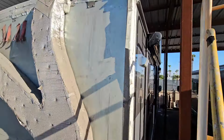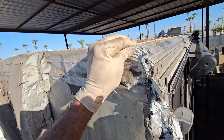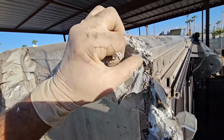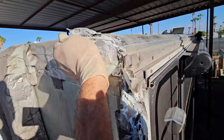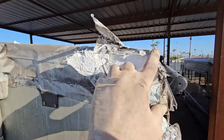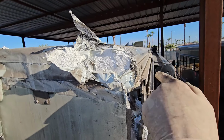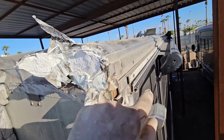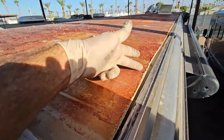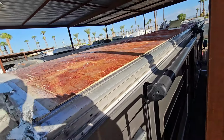But on this 2009 Winnebago Journey, they changed this radius extrusion. I wouldn't say substantially, but it's a lot different. It serves the same purpose, but it's a lot more radius. It's going to be hard to see, but now there's a radius on it instead of there being like a back bevel to interlock with the sidewall right there. It's more just a ledge that it sits on top of. And then we already saw on the roof right here, the Luan is supposed to go over the top of that.